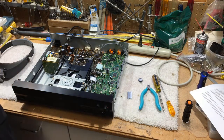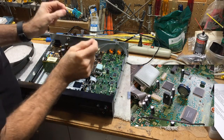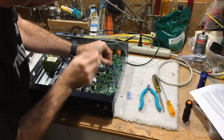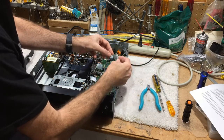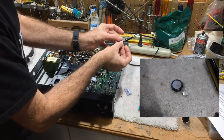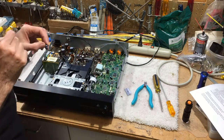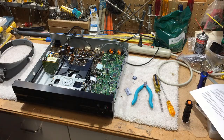It was able to format that CD-RW just fine, so I think that's good news. I did remove the super cap - not the easiest thing to remove. It's got this wide base so it's hard to get at the pin that goes through the circuit board. What I did is use a razor blade to carefully shave away the contact, then I could bend it back enough to get my clippers under there, and it is removed. We're going to button it back up and pray that it keeps working just fine for a long, long time.